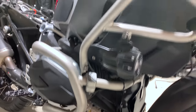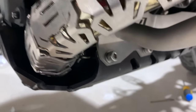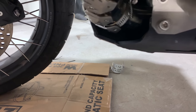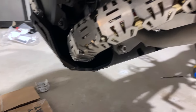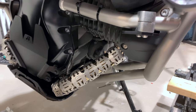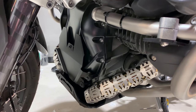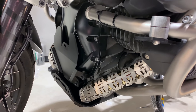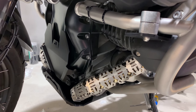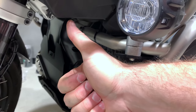Let's look at the other side real quick. So here's the driver's side, left side. You can see how they go in here — there's our mount right there, while they're at the top. Pretty nice stuff actually. I'll leave the links below. Thanks for watching. You'll need an 8mm socket and a little bit of time. I would say install these before you install the skid plate — not that the skid plate is hard to remove, but it saves you about half an hour of lining up bolts again and screwing it back in. Alright guys, thanks for watching. Ride safe.